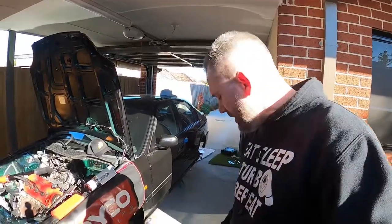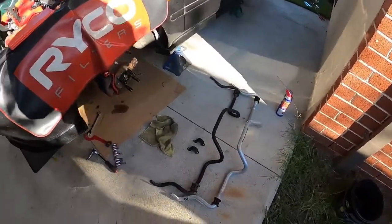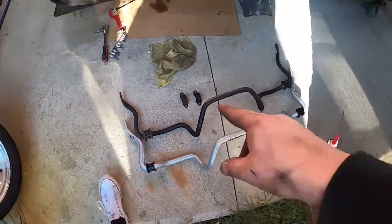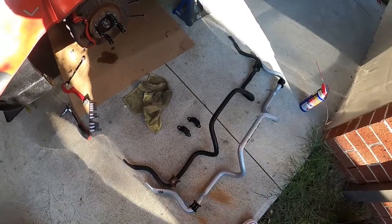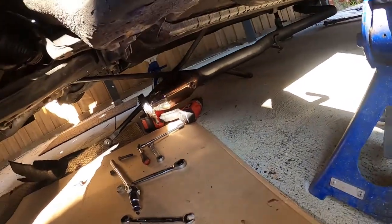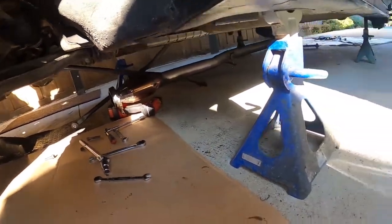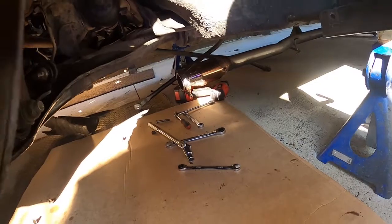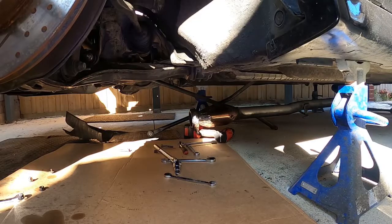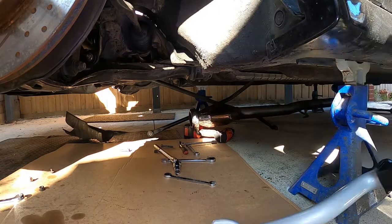I had to stand up — I've been on my back under the car for 15-20 minutes and it's freezing down there. I've got the sway bar out. Side by side they match up perfectly. I've put the bushes on already and there are the D-brackets that are going to go on — I'll put those on last. Under the car was a struggle. I had to drop the exhaust and the gear linkages, then jimmy it through and around while that was all sitting on my head. God, I'd love a hoist — that might be my next purchase.